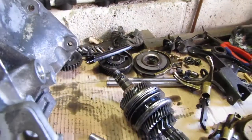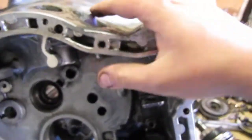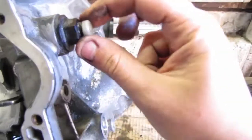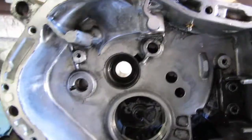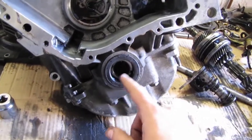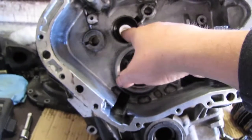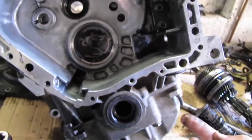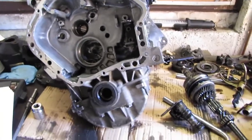I need to go to the dealers tomorrow and order a new one. We still need to remove the reverse gear switch, the fill port and ventilation, and this bracket. The last large bit is the input shaft housing and oil seal, then the differential and its oil seals, then degrease the gearbox — and it should be ready to go off to the powder coaters.